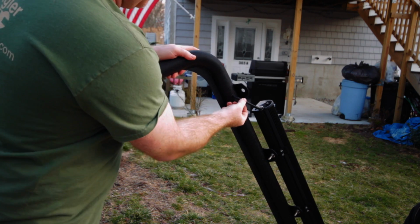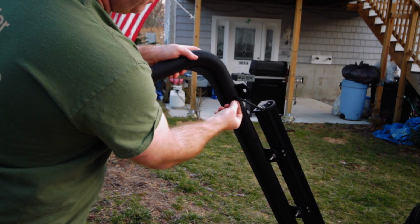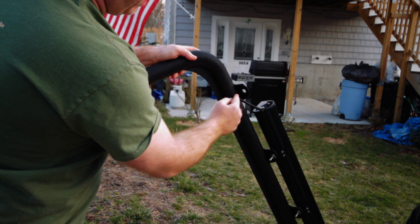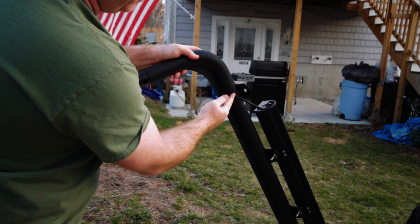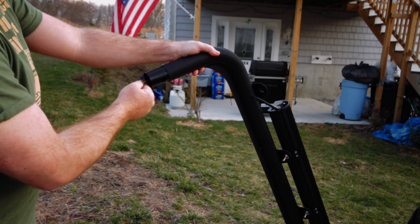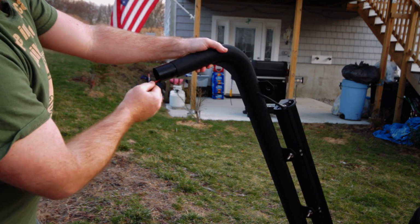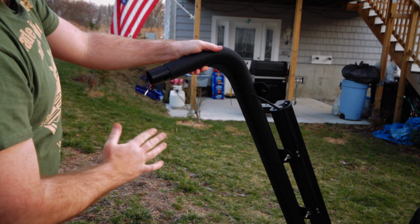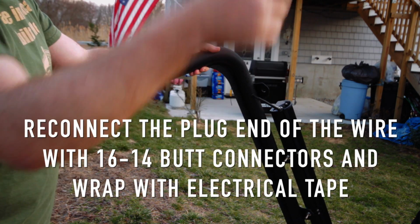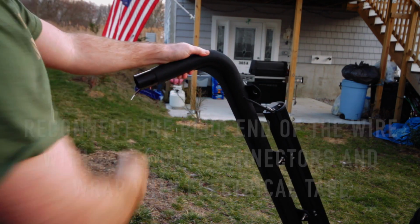Okay, so what we did here is we ran the wire in and then wrapped with electrical tape. So this is nice and neat because the wires actually start to be exposed right here. But we wrapped it all the way through and pushed that through the grommet so it comes through. And then the other end down here, to make sure we got them straight through, we hooked them up to a hanger with some electrical tape and pulled it through to the end. So this whole section is now set up. It just needs to be connected to the other end of this on the top, and then we can connect it to the bottom of the bar, and we're pretty much set. But then the rest of it is just installing this bar.